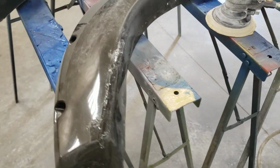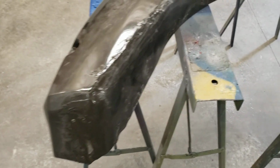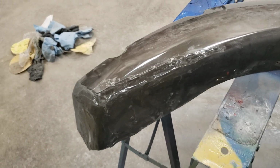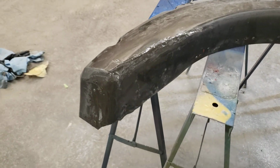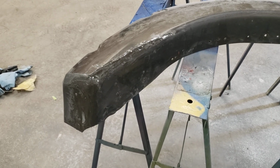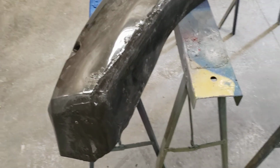But anyway, if you're trying to do those weird little things at home, like a lot of guys, ground effects on Honda Civics, all this sort of thing, especially you young guys, I know there's a glue and some spray paint, and then later the paint doesn't adhere real well to this stuff, even if you use the spray bomb primer, because again, it's all lacquer-based stuff, and it's kind of hokey. Make sure you can buy that primer, and I think there's a clear coat like that as well. There's a little button on the bottom of the can that you snap, and it's a 2-part. And you shake it. That stuff is a 2K product.